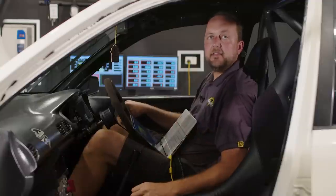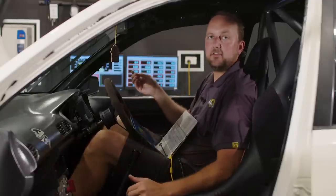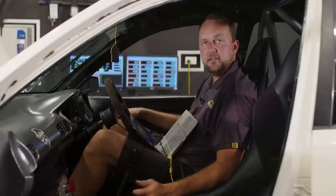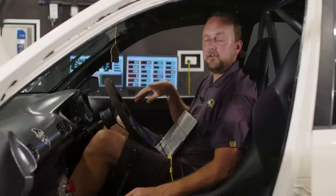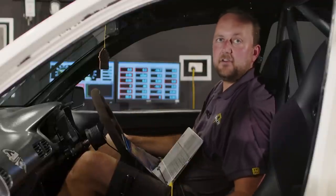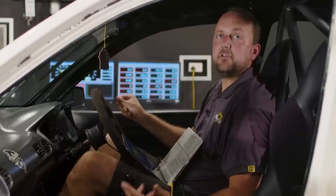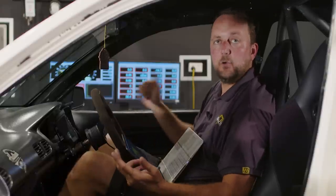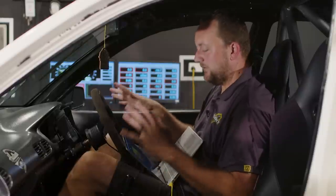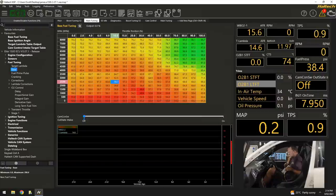First task before we start the engine is to rough in our fuel model. So I know that being a four-stroke engine, it's going to idle at roughly a volumetric efficiency of around 50. Flat out, it's going to be around 100, minus any inefficiencies like our injector flow rate, our injector dead time, our actual charge air temperature, which is a mixture of our inlet air temperature and our coolant temperature, any reverberations in manifold pressure, all sorts of different things. So typically they all get absorbed in the tune, but within reason,